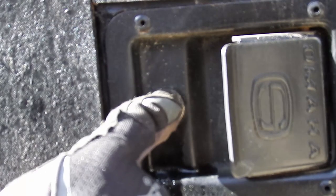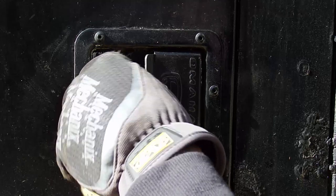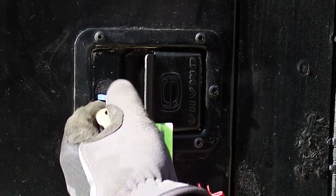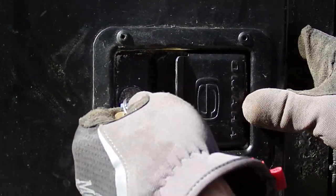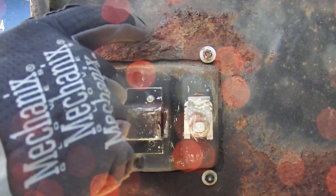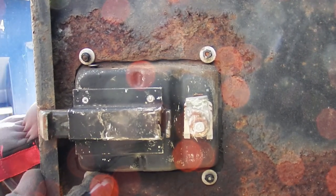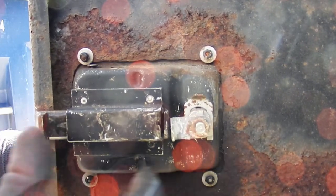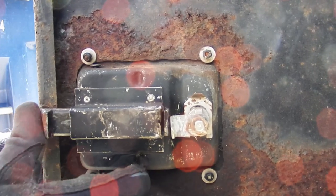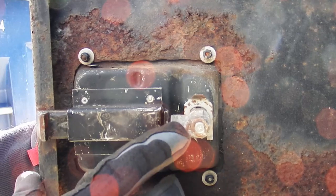Let's take a look at the front door and see what the lock looks like on the inside, to see if maybe we can pry this off or do something else. So this is the front lock — this one I know does work. You can't take the key out when it's unlocked, so you have to leave the key in there to open and close it, which kind of stinks. I'd rather be able to unlock it and leave it unlocked with the key out. Looking inside, you can see the rust. The other side probably just rusted through. Here's how the handle works — it opens the latch. When it's in the lock position, this can't go out. You can still close it because there's a spring in here, but you can't open it with the handle.